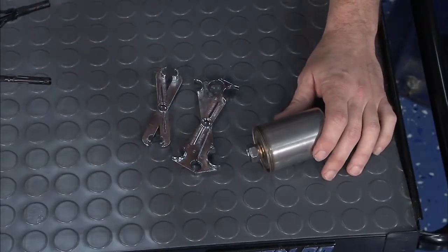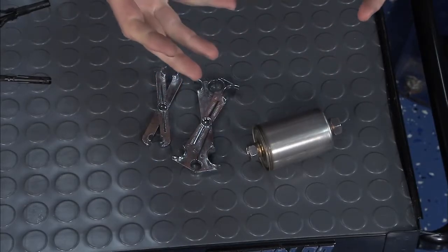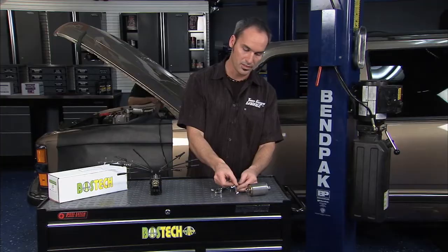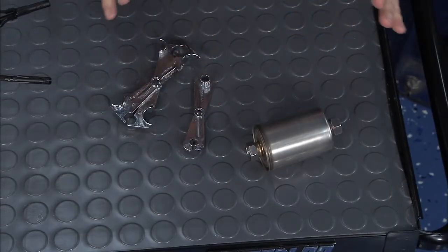It's pretty simple — you can do it at home with a couple of wrenches. Line wrenches work best so you don't round them out. On some of the newer stuff they've got quick-release hoses, and you can get some real simple tools that slip over the line. You insert them in, pop the little release spring, and boom — the lines pop off. Piece of cake.